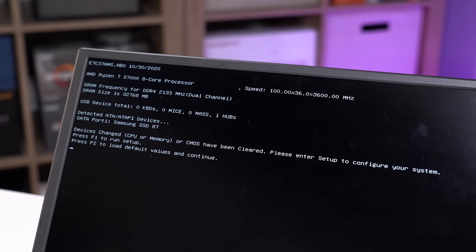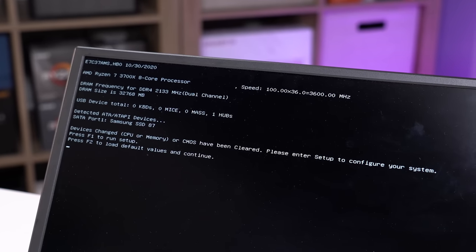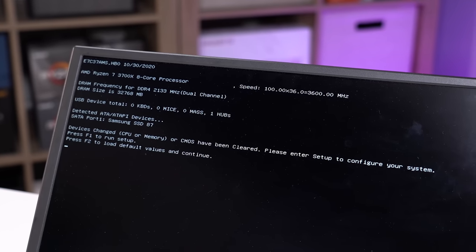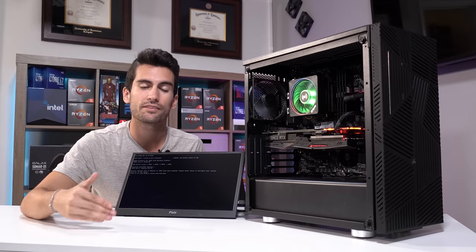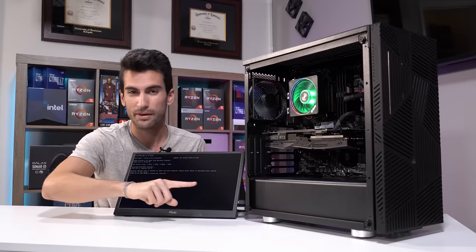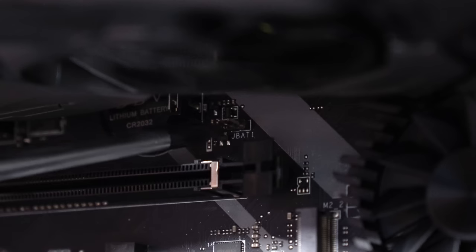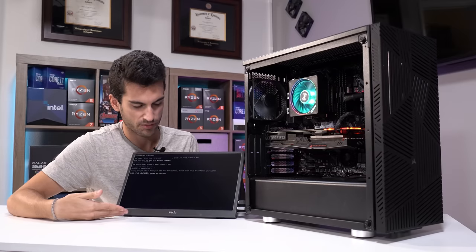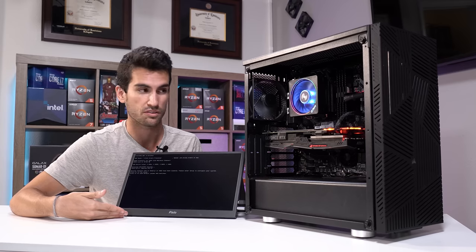Look at that — we have a post! And I know you didn't see what just happened between clips, because it literally took seconds to do, and I was just going to run through this as a precautionary measure. I cleared the CMOS. That's literally all I did — I just cleared the CMOS. There's no dedicated clear CMOS button on this motherboard. This is an X570 board, but you have to jump the two pins — JBAT1, for those interested. But this here is a post, and all we needed to do to get this system to post was clear that CMOS.